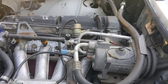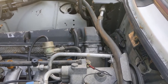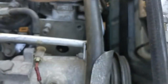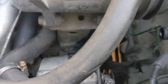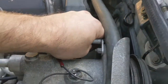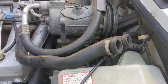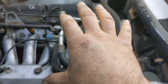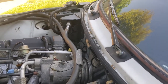Now I'm ready to deal with the AC compressor. I'm not actually going to move it at this time — I just got everything loosened up. These are the two top bolts, six-millimeter hex. I'll remove those and set them up in the gutter so I know where they go. I've also loosened that bolt down there. Now I can actually move the AC compressor completely out of the way — I'll leave it right where it is for now because I don't want to put additional stress on the hoses.